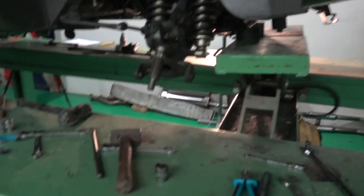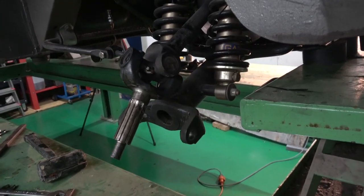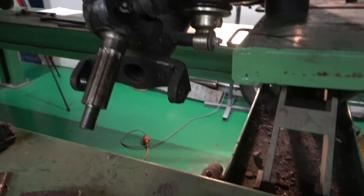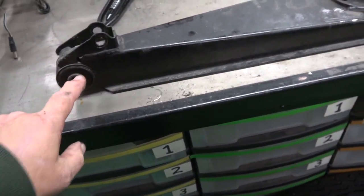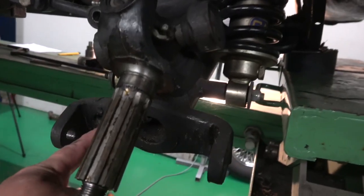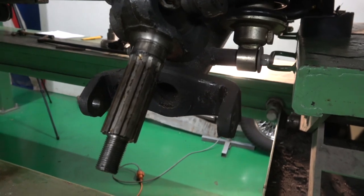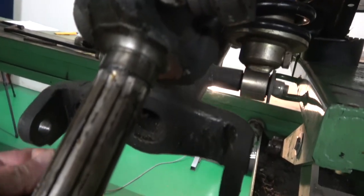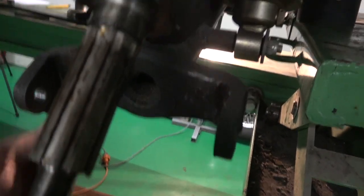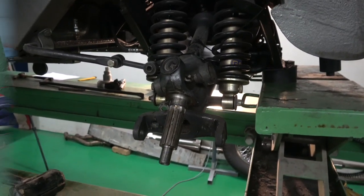Anyway, so as you can see on this side, I can bring the light round later. But as you can see on this side, I've got the anti-roll bar off, and this is where the bolt goes into here to hold the back of this arm on here. And you can see how it's a blind bolt in there, and it sits and it's captive in there. I can show you once it's all cleaned up, but basically this is a perfect recess for the head to go in. So I'll go and take those two bits out and then I'll bring you back.